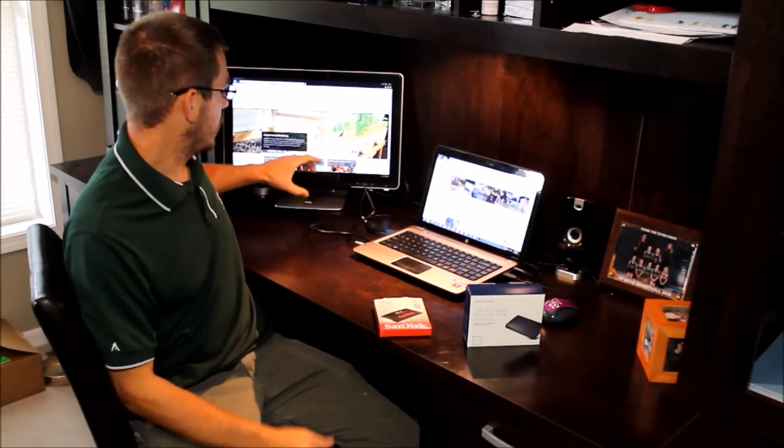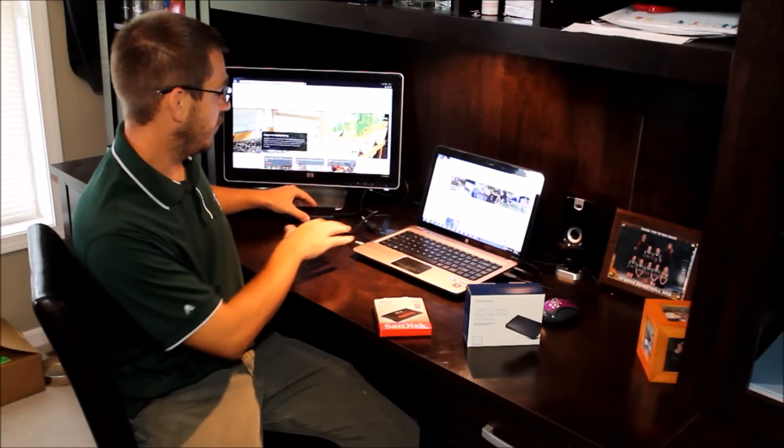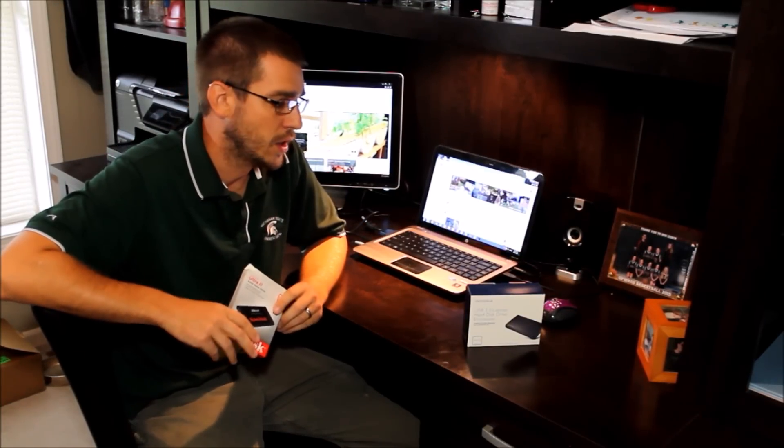I've also got my old hard drive in the hard drive enclosure here, just plugged into the computer, so I have access to all the data that was on the old hard drive. I didn't do any cloning, I didn't have to do anything complicated — just pop the hard drive in that enclosure and plug it in once we're loaded back up on the new drive. Very inexpensive way to increase the speed of an older computer by leaps and bounds, and this will probably add another few years of life to the system.